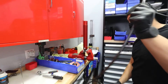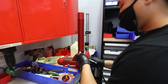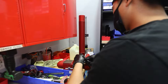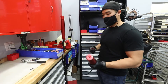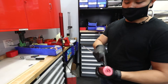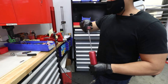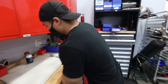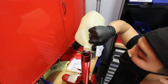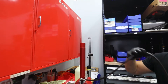Go ahead and pop these on. Now that we got the body hooked up to the canister, the next thing to do is to bleed the fluid. We have this little rod over here that connects to the bottom of the divider piston, and using my body weight I'll go ahead and bleed this. I'm going to top off the fluid just so we don't get any more air inside there, because we go all the way to the top. I'll do this three to four times.